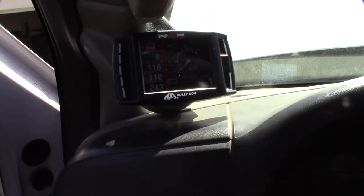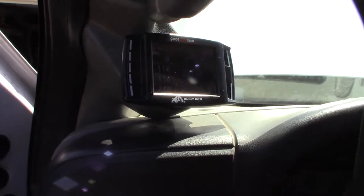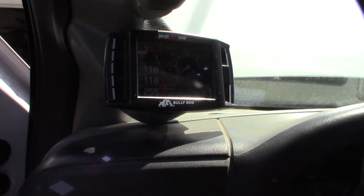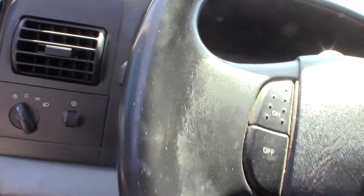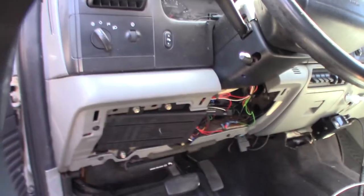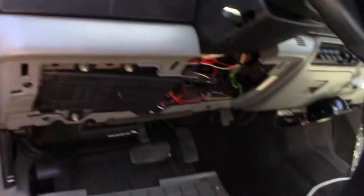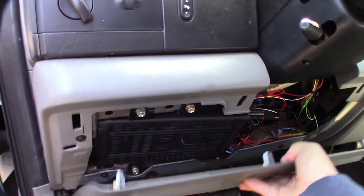There you go — it's reading between zero and one right now just because the engine hasn't heated up yet. Once it does, it should build some pressure. Same concept would apply with a standard electric gauge. I'll put links for the sensor and that adapter piece in the description. And I'm not worried about my coolant blowing up in my face anymore.